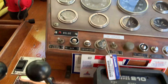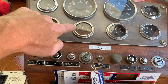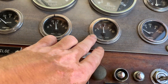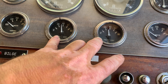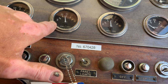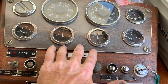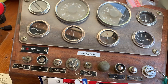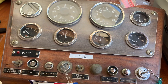Doing a little test on both of Molly's engines. I cold-started them up separately, noted the oil pressure upon startup with a cold engine, and made a reference mark on each dial glass indicating what the oil pressure was at idle when the oil was cold. Both of them are basically the same, hovering right around 30 psi according to these gauges. I'm going to install a mechanical gauge temporarily to check oil pressure.